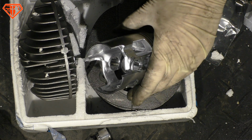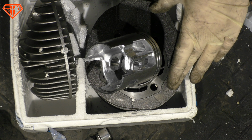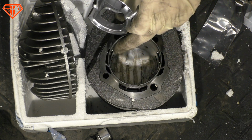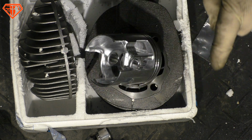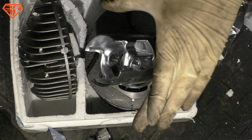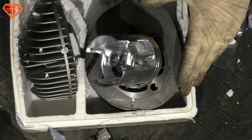Another trick you can use is the anti-oil sucking trick, because a lot of engines do suffer from gearbox oil sucking, which does not matter at all if you have an original cylinder, but it does hit in as soon as you use tuning cylinders. So around the crankshaft, exchange the M7 stuff and just tighten it really hard. This will minimize the gearbox oil sucking and this setup will work much better.